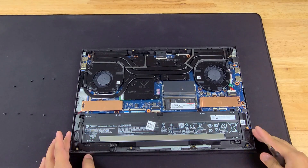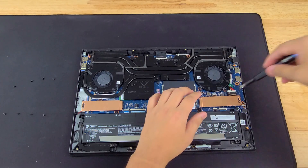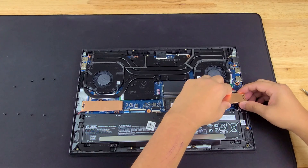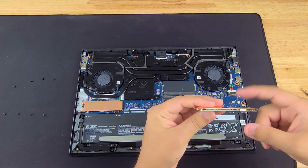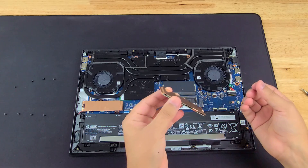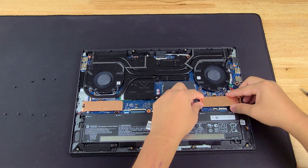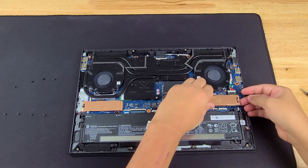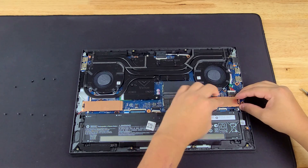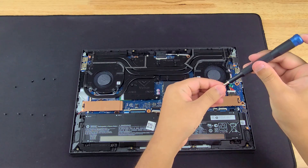As for the NVMe, we're not changing this today, but I am going to show you how to take this apart. It is covered with a copper plate — I'm going to take one screw out, and it's going to kind of lift at an angle and come right up. Now this copper plate comes with a thermal pad that's kind of stuck to the NVMe. You're just going to simply peel that back, put it on your other NVMe and push it down again. Start it back in — place it down again to match, and then put the screw back in.